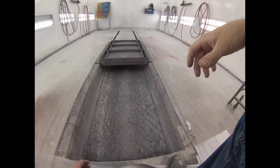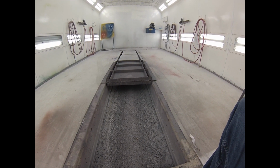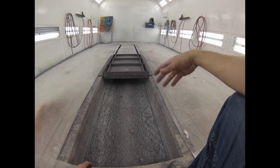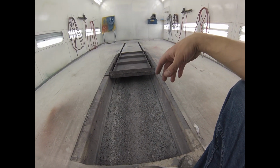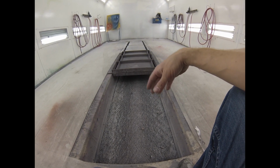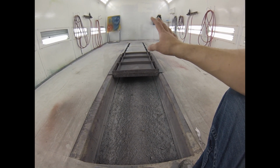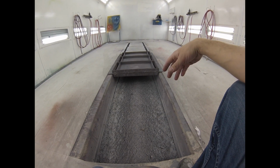Because the air that's coming through here is perfectly clean already, and there's not any particles in it besides overspray. And the overspray particles are actually quite big when you're talking about dust. So it's easy for this filter to catch almost all of it, especially if it's installed properly. There's no holes or gaps or anything, right? And this one too, when it gets plugged up, you can't balance the manometer anymore, and it'll start blowing open the doors on the booth, right?